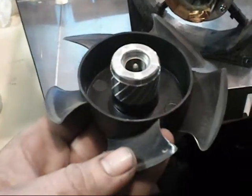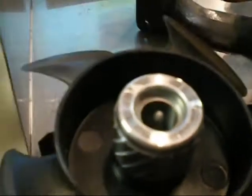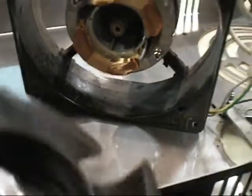This is what the motors look like on the inside. It's just a one straight bearing shaft, a clip on the end to take it out with a moulded fan. Just drop a bit of oil on that, put it back together — just a bit tight.